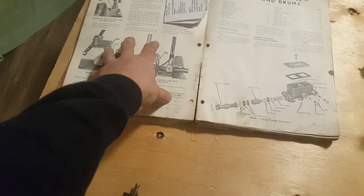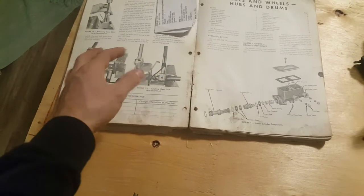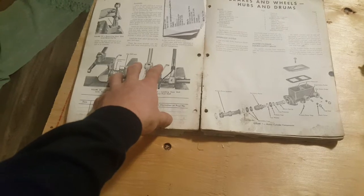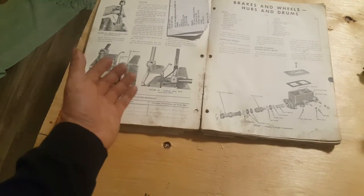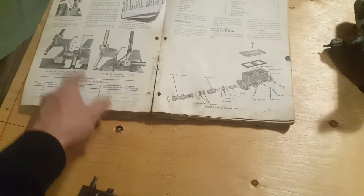consider the distributor, for example. There's an AC Delco distributor, and there's an Autolite distributor. So I'm thinking that some cars came from the factory with the AC Delco unit, and other cars came with the Autolite unit. But of course, 60 years later, we don't really realize that. So I think here is the same thing. The distributor, they only show one distributor. They give you the part number for the other one, but I think only one picture. So here's probably the same thing. Some cars came with this rounded version, and some came with this rectangular version.